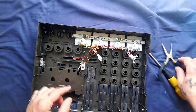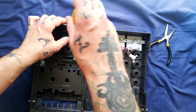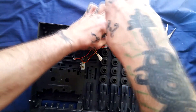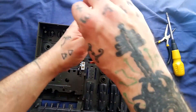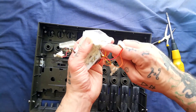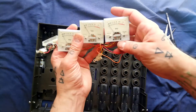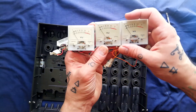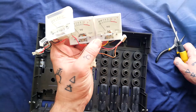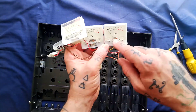Last of all, this plate is holding in these VU meters. I'm not going to detach the two screws holding the voltage regulators onto the plate, but there's one on either end and one in the dead center — three screws — and that plate will lift out, allowing access to the meters. The two halves of these are held on with tape; you can usually cut through or pick off the tape. Use a soldering iron to detach these fuse-type bulbs, that is if you can find a replacement. They're called festoon type bulbs. I haven't found a new-old-stock supplier or somebody currently making these, so you'd need to do your own research to try and track them down.